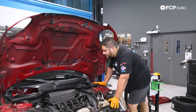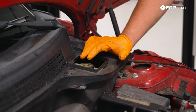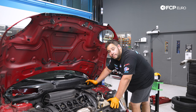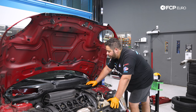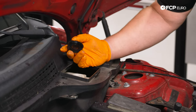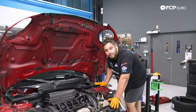Before we get started, it's always important to note the brake fluid level. If the car's brakes were worn and the brake fluid light came on due to open pistons, someone may have topped it off — then when you compress the pistons, you'll overflow the reservoir. If it's too full and brakes are low, pull some out using a syringe. Top it off once the car is back on the ground and the brake pedal has been pumped a few times for a proper reading. It's also not a bad idea to inspect the brake fluid condition and consider a flush while the car is in the air.